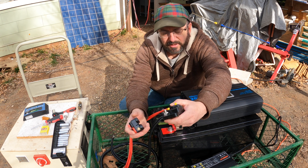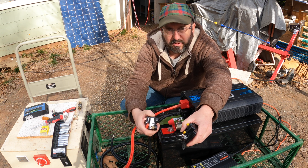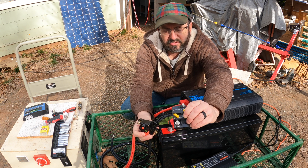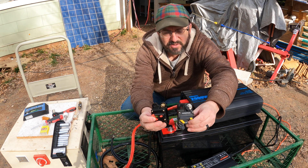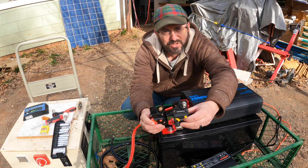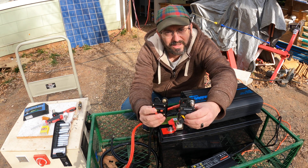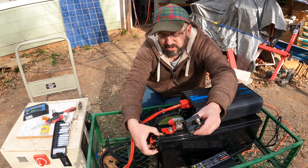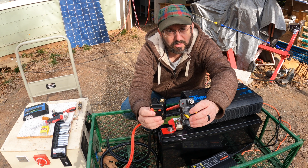You could also use circuit breakers. The advantage to a circuit breaker is that you can trip it and separate your components. But if you're going to use a circuit breaker, realize that not all circuit breakers are created equal. You'll want to match the amperage to your system, but make sure you use either a Blue Sea Systems or a Bussman circuit breaker — don't use a cheap one. I don't particularly like using circuit breakers for this application because they're clunky and you have to mount them and run a wire to them. I prefer using the fuse, but you could use a circuit breaker as well.